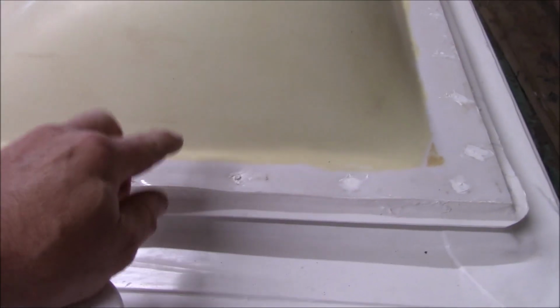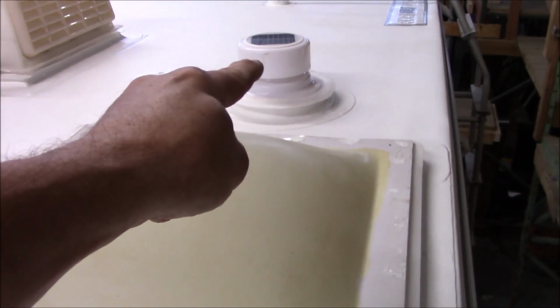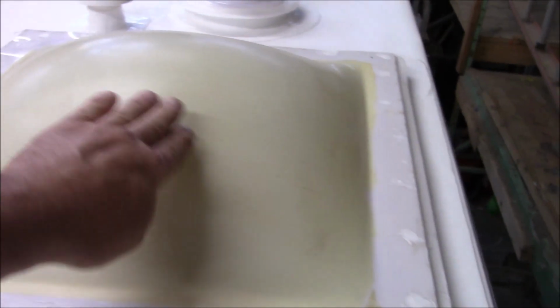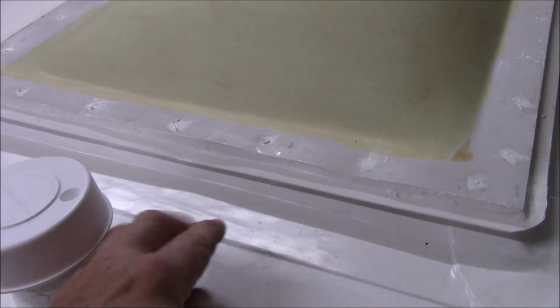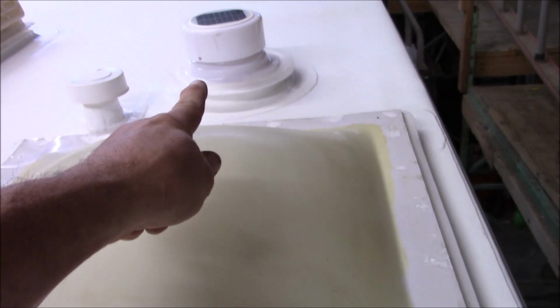There's an inner lens in here. This is a vent right here, and we got a trough going in here, and there's a trough going over there. That's a solar fan. So when the sun comes up to evaporate what's on here, then again, that moisture that wants to condensate on the inside, we want to get rid of it, so that solar fan will kick on. The solar fan gets this draw from here, the air goes through this ductwork we have inside here, goes up over the inner lens, comes back down, and gets exhausted out.